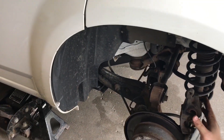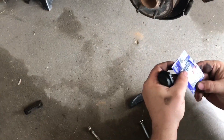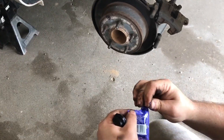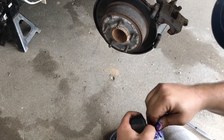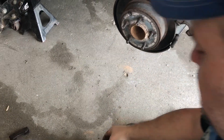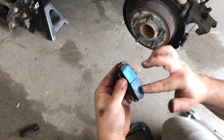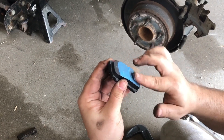What we're going to do, we're going to get the new brake pads. This is lubrication for the brake pads. When you change brand new brake pads, they're not broken in yet and they make kind of screeching noises. I'm just applying a light coat of this — you don't have to get real crazy with it.